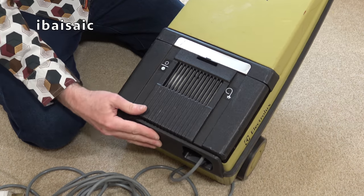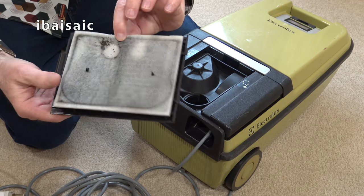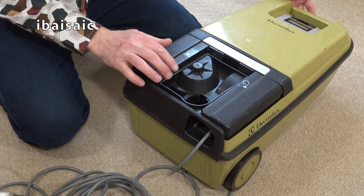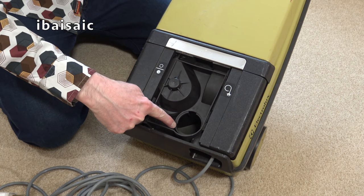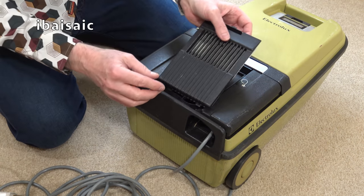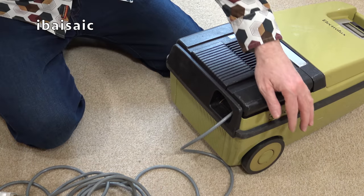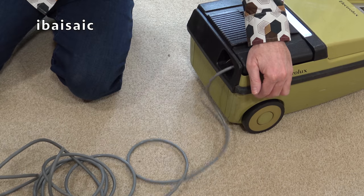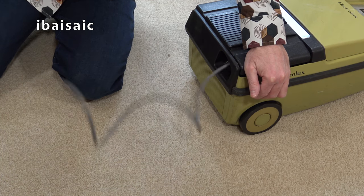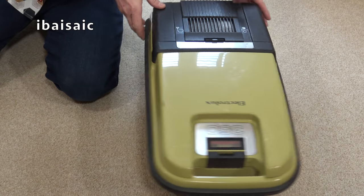So here's the exhaust vent, which will open up like this. It's pretty mucky — that definitely could possibly be washed. But I'm pretty sure I can get new filters for this, if I haven't got any in my stash. And you don't need an adapter with this — there is a blower outlet and you can attach the hose directly to that. Something you don't see very often on vacuum cleaners these days, a blower outlet — but it's surprisingly useful for various applications. Let's just rewind the cable, make sure that works as it should. It's a bit squeaky and slow — I think a little bit of a clean and a grease might sort that out.